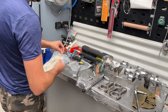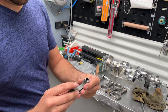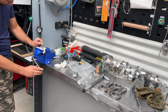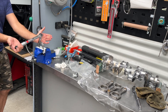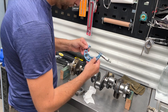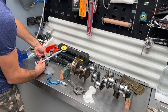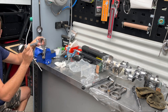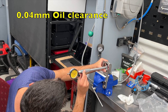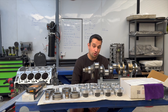The next step is measuring oil clearance on the rod bearings. We assemble all the parts just like you were putting the ends together — clean them up, carefully insert the rod bearings into the rods, use the provided bolts and torque to specification at 75 Newton meters. Using a micrometer, we measure each journal on the crankshaft and transfer the readings onto the bore gauge. We then use the bore gauge on the bores in the rods to verify we achieve the desired oil clearance of 0.04mm — this was spot on.